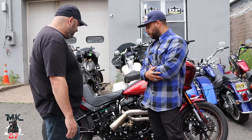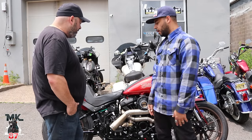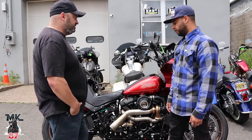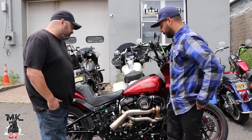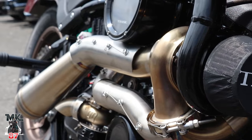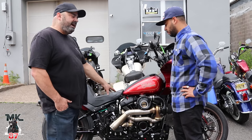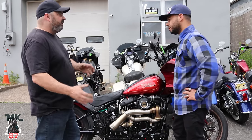What are the numbers they're telling you that you're going to be getting out of this? We're being told around 160 horsepower to the wheel and somewhere around 160 foot-pounds of torque. We took Trask's recommendation and put a Redshift 468 cam in this thing, because when you build a turbo like this, you want a low-end torque cam. The torque starts giving you power at the bottom end, and then the turbo takes over — you don't want anything coming up in the high revs.